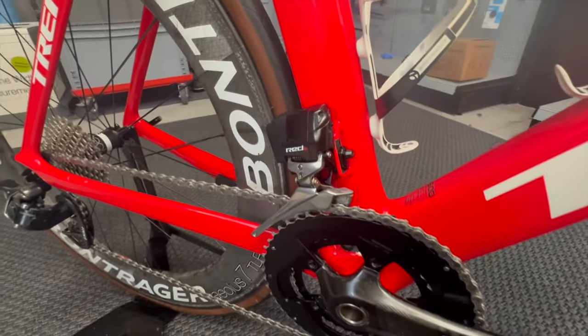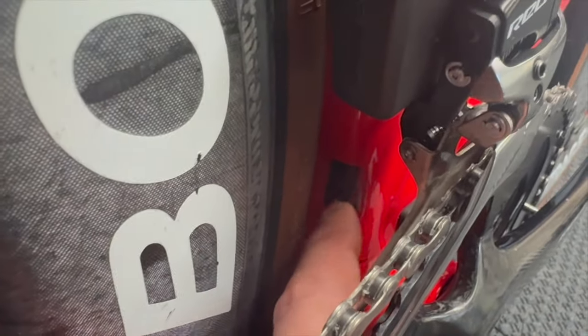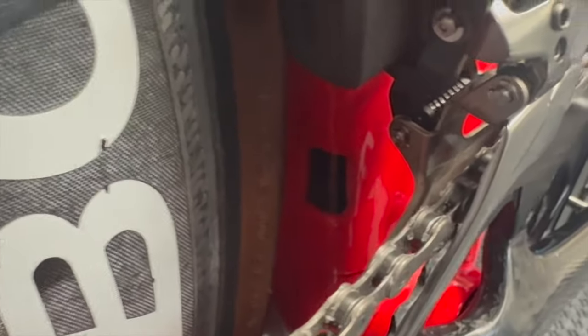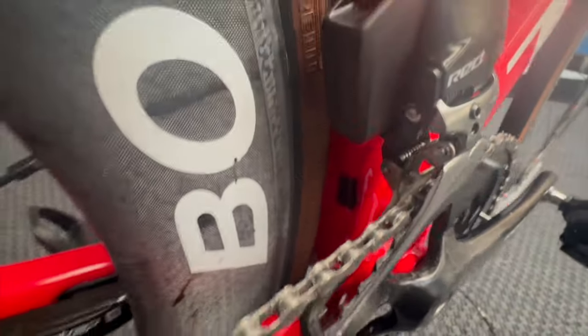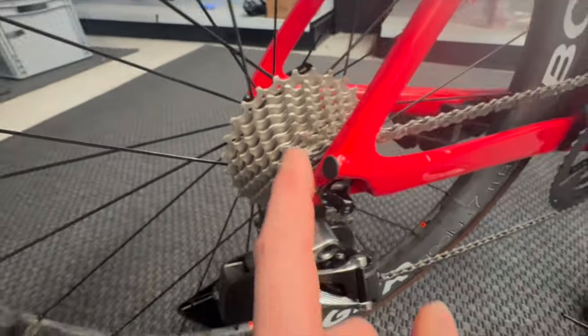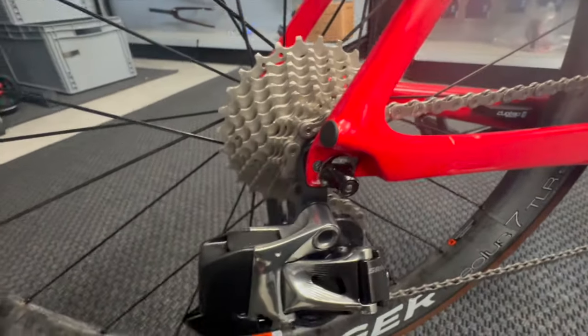Front mech-wise, nothing special other than around the back here, which is quite important. There was a wide open hole in the back where you'd have cables going in — a mechanical cable or electronic cable such as Shimano Di2 — and it had a gaping hole there which let all the junk in straight off the tyre into the bottom bracket area. We've just moulded a bit of shield onto it. I'm sure you could probably get a blanking plate for it — if you do know about that, stick it in the comments. But this is a great solution for now; they mould up really nicely when you heat them with a heat gun. We've also put a bung on the rear end hole as well, which was also letting water into the bottom bracket and frame.